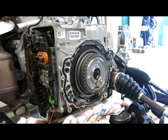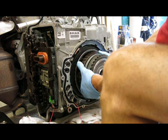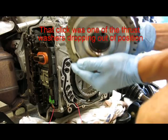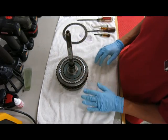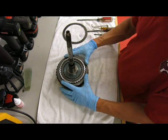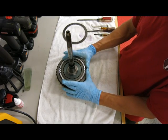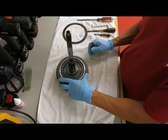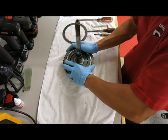The cover's off with its clutches. Here's the clutch pack that has the infamous 3-5 reverse wave plate in it, and it's at the very bottom of this stack. There is supposed to be a special tool to take this clip out — there's a ring that holds everything in. But I believe we can do it with more basic tools, so I'm going to give this a shot on camera. I'll err on the side of caution — if I cannot get this out I'll take it down to the dealer and ask them to pull it for me. I don't think that's going to be necessary.